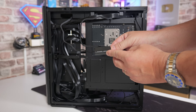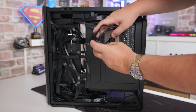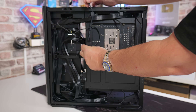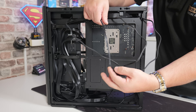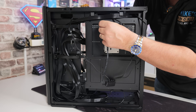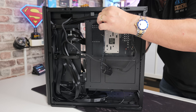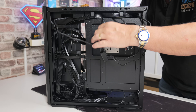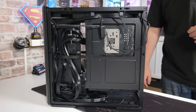There aren't any sticky pads included, but if you want, you could stick the hub somewhere convenient on the back of your chassis. Take the CPU fan header plug and pass it back through into the front side of the board through one of the top holes. You can leave it loose for now and do cable management later if necessary.